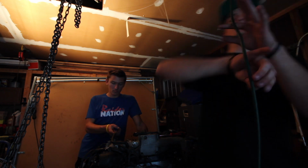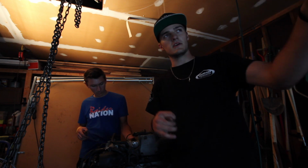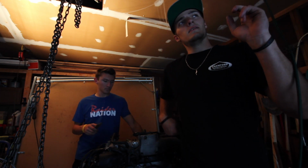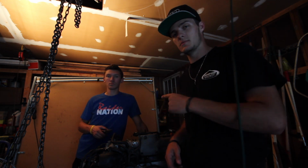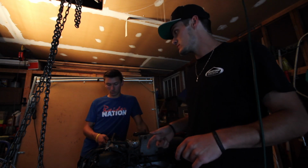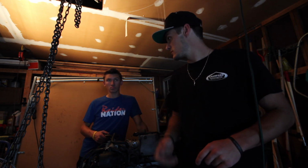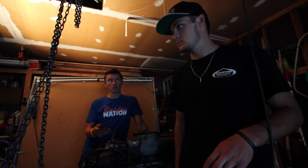So let's take this for instance. After I've been driving around in my car with the stock TD04 turbo, everything's pretty much stock for powertrain. Since I'm borrowing his Access Port right now, the highest I've ever reached for boost was just under 18 pounds. I wonder how much you're going to be running at peak for yours. Once I'm tuned, it's probably like 22, 23. Because I know Adam hits like 23. His peak is 22. 22, yeah.